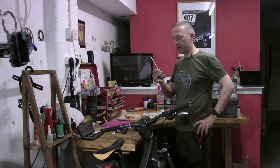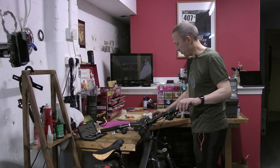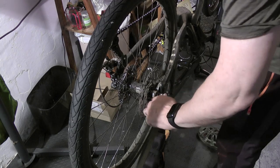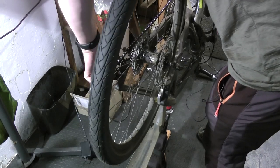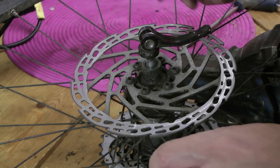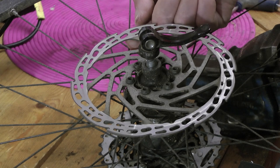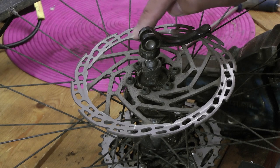I've just moved the bike into my little workshop area. I have my torque spanner and the vernier calipers. We're going to turn the bike upside down. I'm beginning to think I really should have cleaned this bike before attempting this job since I rode it yesterday. Let's lift the wheel out — grit going everywhere. On close inspection there's definitely a ridge here on the top of the disc, and on the other side I can feel that with my fingernail. That's the first indicator that a disc is worn.